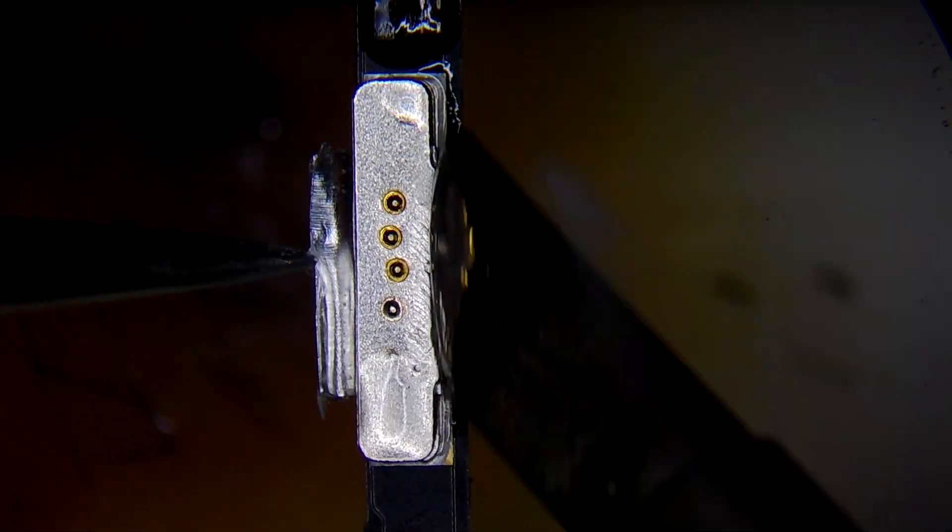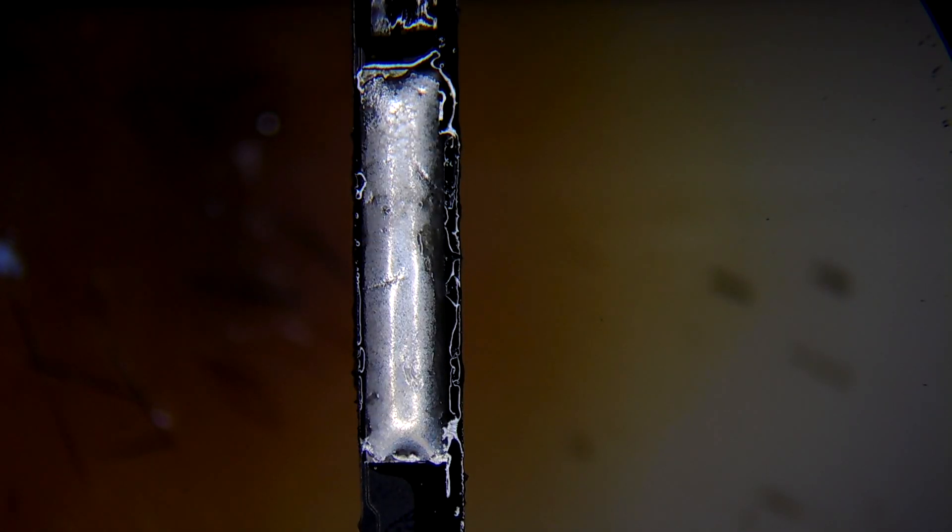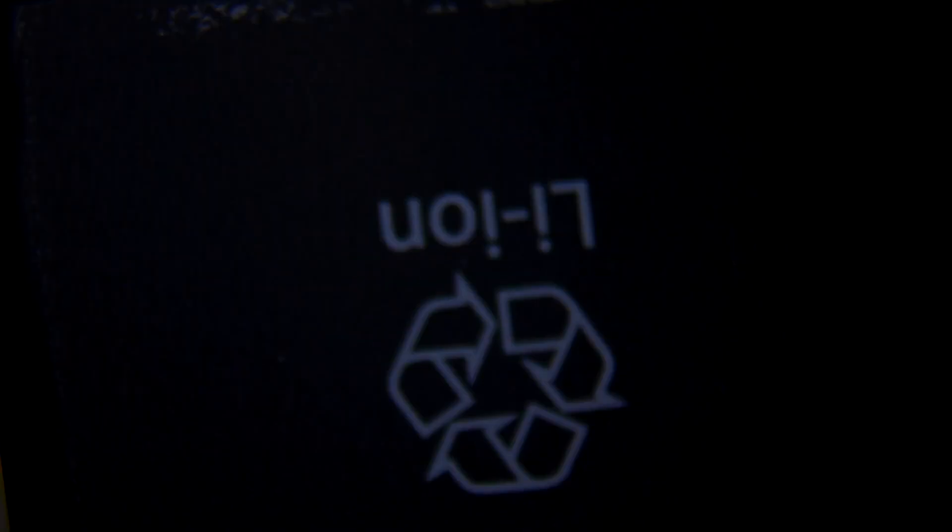Now the fun part — removing the metal contacts from the anode and cathode, I'll just call them metal baskets. You can desolder with the battery connected to have the two baskets on the new battery, making it easier to solder to the BMS, or you can remove the baskets and clean with the soldering iron. By the way, I'm using the Hakko FX950 soldering station with a special tip that helps get the temperature right. I'm using 240 degrees Celsius — use more and you may damage the BMS and need to swap the EEPROM to another BMS.